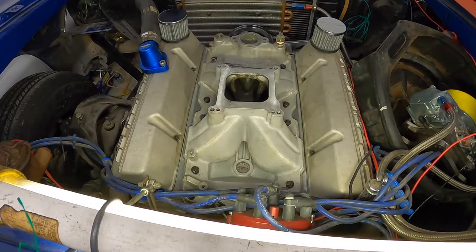And I, on the other hand, have to depend on the machine guy to do his job. When I'm putting them together, I don't just check one or two bearings. I check every bearing. And critical stuff, like you're building a $15,000 motor and you use an old set of rod bolts. Why would you do that? You can buy a brand new set of rod bolts for $60. So you jeopardize $15,000 worth of motor for $60. Yeah, that's cheap insurance. And that's just crazy.